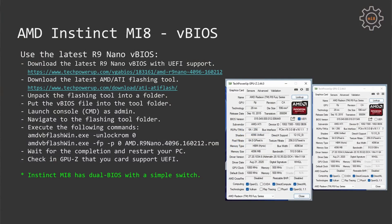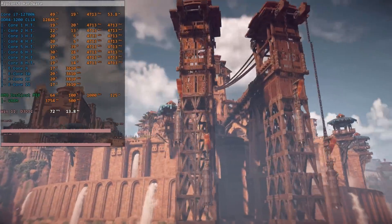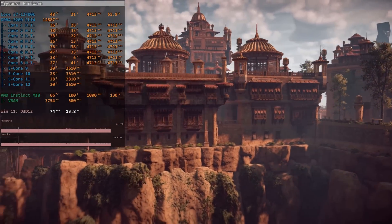The next step after fixing the cooling would be the video BIOS of our Radeon Instinct MI8. The graphics card has identical technical specifications compared to the R9 Nano, and the BIOS between these two cards is interchangeable. You can forcibly flash R9 Nano BIOS into the MI8 — there are also lots of online instructions on how to do that. The R9 Nano BIOS does not give performance advantages, but it does give one key feature: the default MI8 BIOS does not support UEFI. If your system is running in UEFI mode, there is no way to get video output in BIOS using MI8 as your primary graphics card. But if you flash the R9 Nano BIOS which supports UEFI, this card magically transforms into an R9 Nano with UEFI support and works just like any regular graphics card.